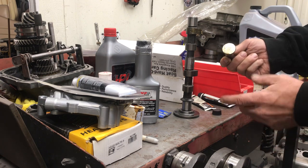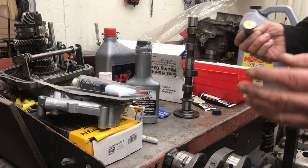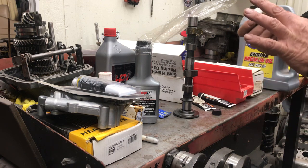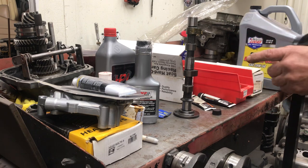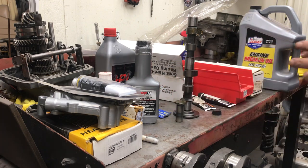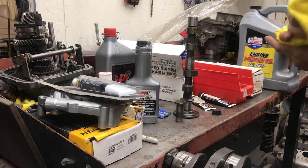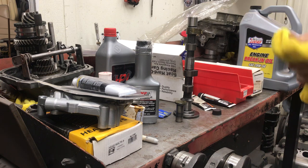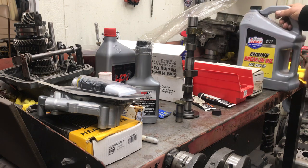That's why it's important to have that oil splash at 2500 to 3000 RPM for 30 minutes. What I've found is you don't always have the carburetors perfect and the timing isn't always set perfectly, so I don't like doing that 2500 RPM for 30 minutes. Instead, I put extra oil in the motor so it's splashing around in there — if the motor holds three quarts, I'll put four and a half in it. Then after the break-in period I correct the oil level, take the break-in oil out, and put some normal oil in.